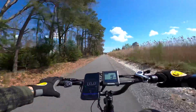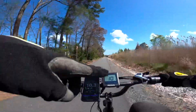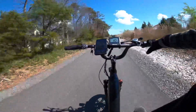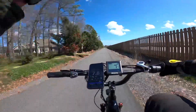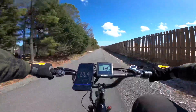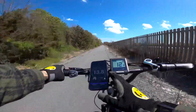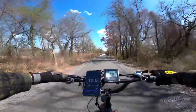Let's go through all the pedal assist levels. I'm going to ghost pedal. Just so you know, I'm almost six feet tall — 5'11" — and pedaling this bike feels very uncomfortable; my knees are reaching up super high. A longer saddle to sit back further would help. Pedal assist one tops out at 10 mph. Mode two: the cadence sensor kicks in pretty quickly — unlike a torque sensor, it just goes full throttle. Mode two tops out at 14.2 mph. Pedal assist three: top speed is 16.5 mph.